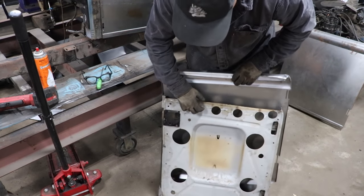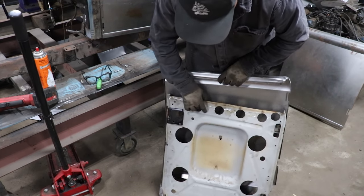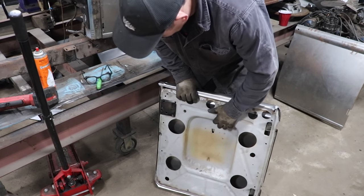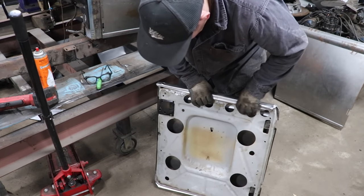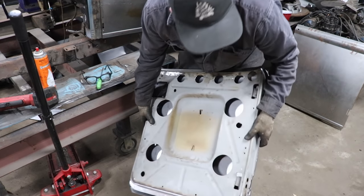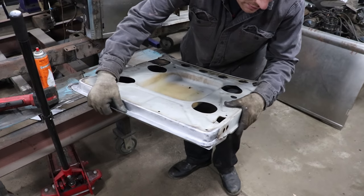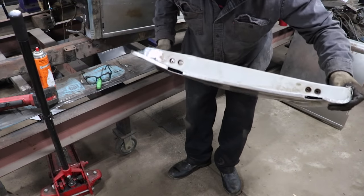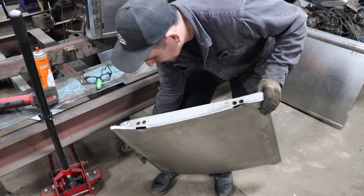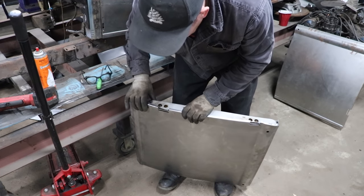So what we can do is this top edge here, it actually fits up in this little groove here, not behind this flange because like I said it's spot welded right along there. I know this top edge is going to be a little wonky, especially back here - you can see it was messed with and pulled and hammered and who knows what. So I'd expect that not to be good, but the skin fits our structure. Down here at the bottom it definitely needs some pulling. Looks like the cutouts for the hinges don't exactly match, but they're close. I'm just going to have to figure out a way to clamp it.